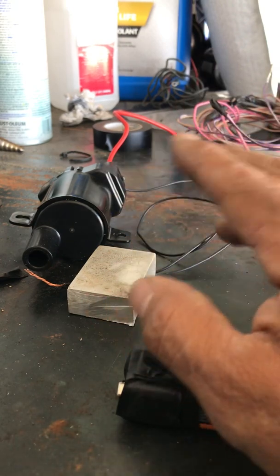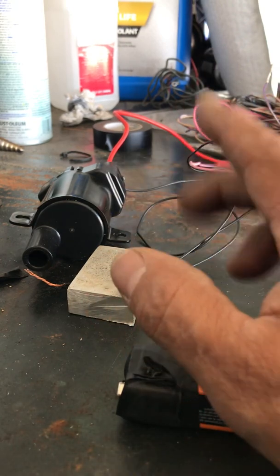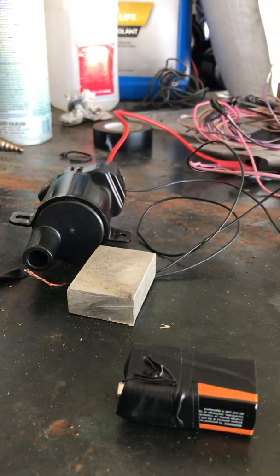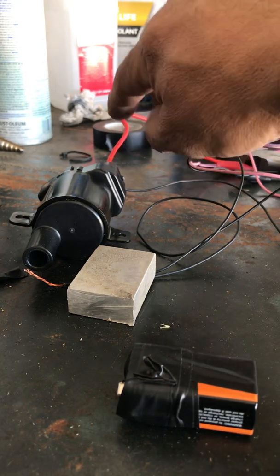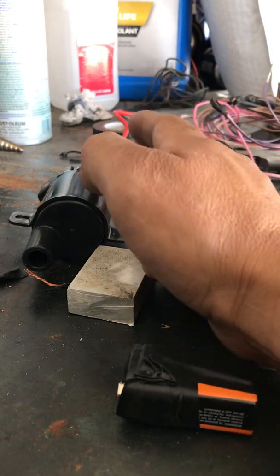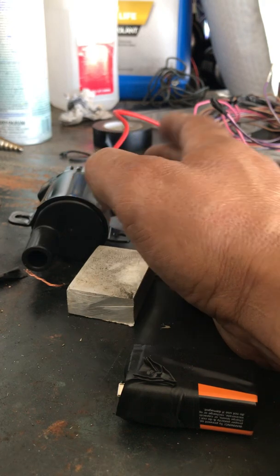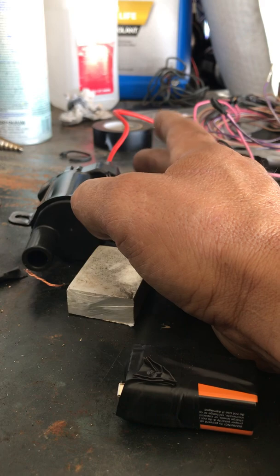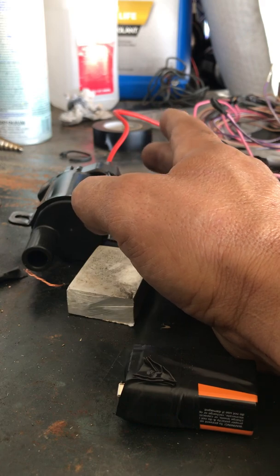Then I had to chase where my problem was, because I didn't know how the wiring went on these. I looked into it — it has two grounds: one ground for the chassis which is black, the other ground is brown coming from the computer. On the top pin is going to be a pink wire that's your key-on, and then the second pin — the second wire from the top if you're looking at this clip — that's going to be your signal wire. It changes according to cylinder; on cylinder 1 it's purple.